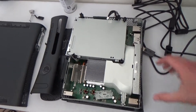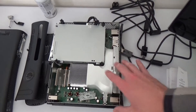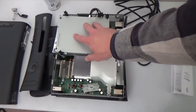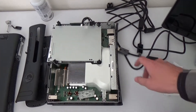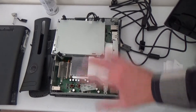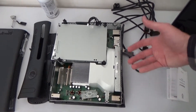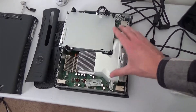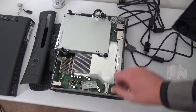This one's a little bit interesting. Normally when the Red Ring of Death happens, you still have system power — the fans are able to go, the CD tray can open and close, still spin and whatnot. But when this box died, nothing. It still had the Red Ring of Death, but it essentially had a hardware fail beyond just the heatsink sliding off.